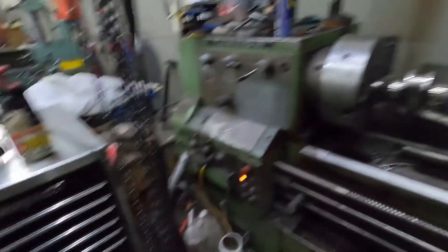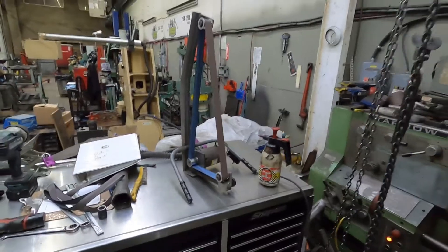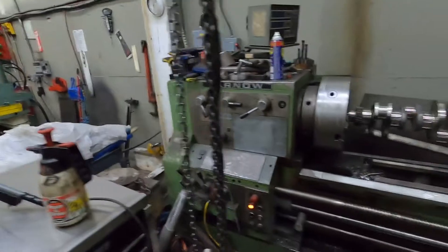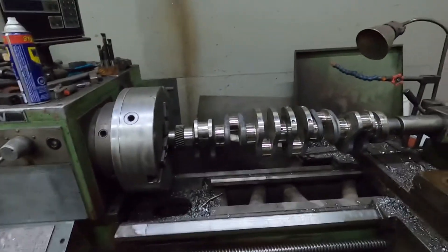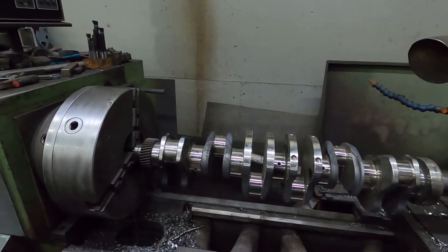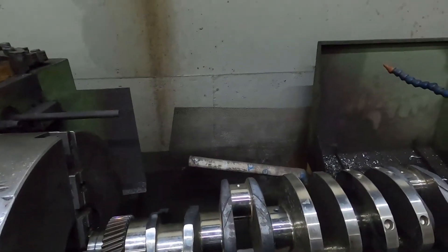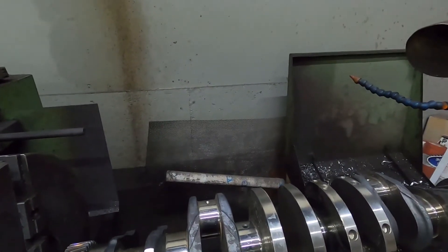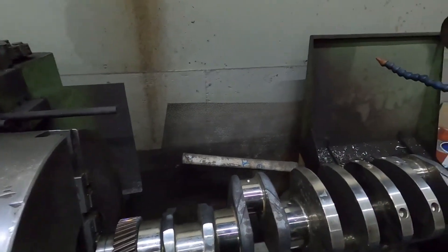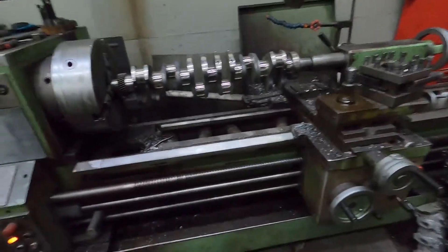This is the tool for polishing crankshafts. It's basically just a belt that spins, and you spin it in the opposite direction of the crankshaft — just so you get an even polish all the way around. You're trying to take off any imperfection or sharpness that's there, because once in a while you'll get a line in it that you can polish out. That's basically all you're doing.